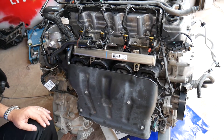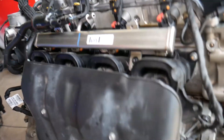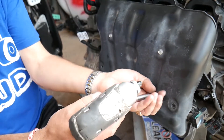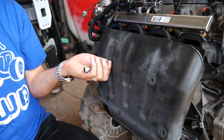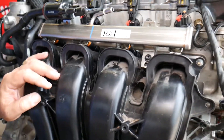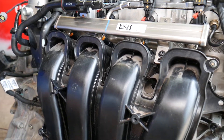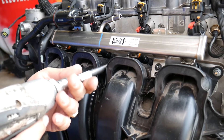We're getting closer. We need to remove two nuts, three bolts, and four screws right here — these four use an 8-millimeter. That whole thing comes out. We have two more bolts hidden here that require a 10-millimeter socket. One is on top in the middle.